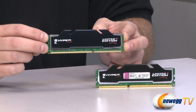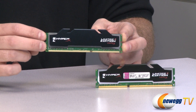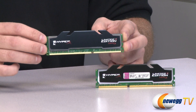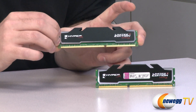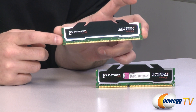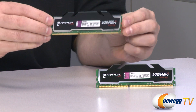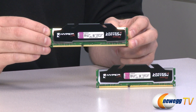Here is a close-up look at the memory itself. We have two DIMMs — these are DDR3 240-pin DIMMs. DIMM stands for Dual Inline Memory Module. You can also call it a stick of memory, but DIMM sounds a little bit fancier. Remember when you're installing memory that there is a notch that is offset — it's not quite centered — so you can only plug it in one way.